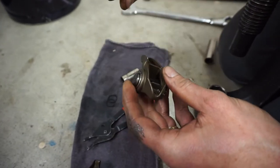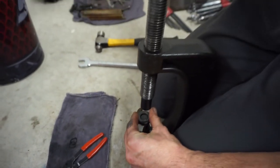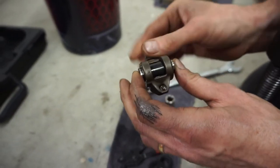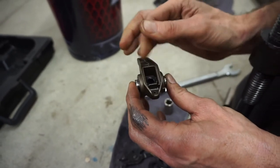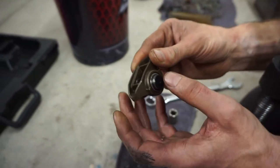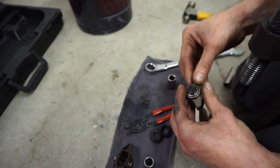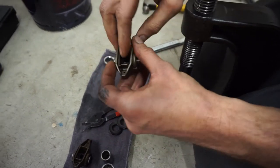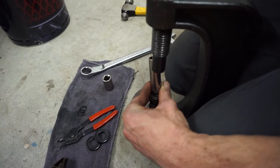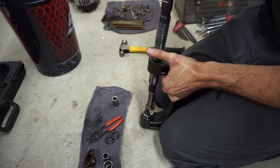It comes with tools — you put them on both sides. There's supposed to be a stopper, but you've got to be careful. By feeling it, you can tell if it's a little tight and binds as it rotates. The tool can over-clamp the outer bearing, so I've been backing it off a little on each one individually to give it room so it's not binding.